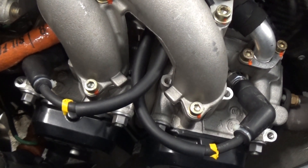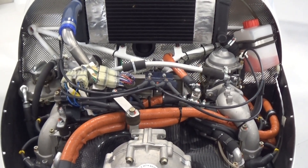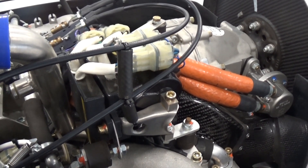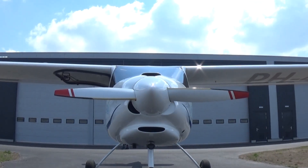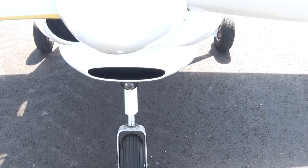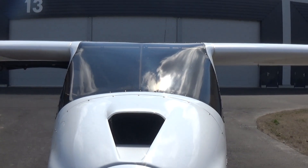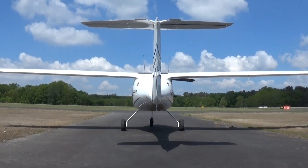This plane is fitted with the ever-reliable Rotax 912 80 horsepower engine. While some may question whether 80 horsepower is enough, those familiar with PPcell know that their designs maximize performance with the given power. The propeller is PPcell's own design, manufactured from wood and then protected with a durable covering, including leading edge protection. Being a wooden propeller, there is very little vibration, which contributes towards the smooth running of the aircraft. A special covering makes the propeller very durable, offering years of use in a normal training environment.